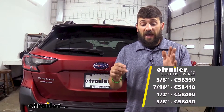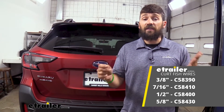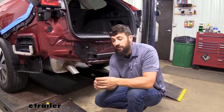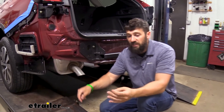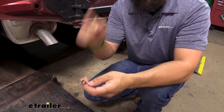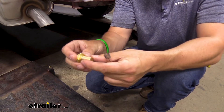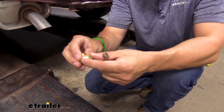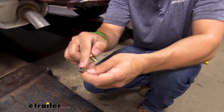For starters, you're going to have a 3/8 inch, a 7/16 inch, a half inch, and a 5/8 inch. The first thing we need to do is determine what size fishwire we need. When I talk about size, I'm not talking about the length of it — I'm talking about the size of this coiled portion here. There are all different kinds of sizes that are going to match up with the common sizes used for hitch bolts. This one here is a carriage bolt with a 7/16 inch diameter, so we're going to be using the corresponding 7/16 inch fishwire.